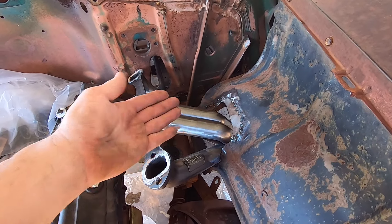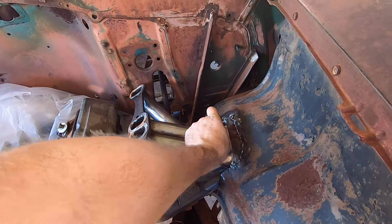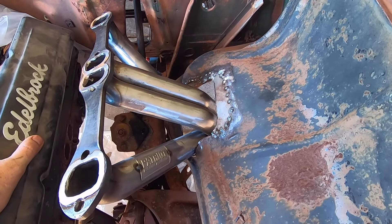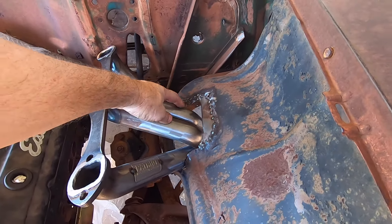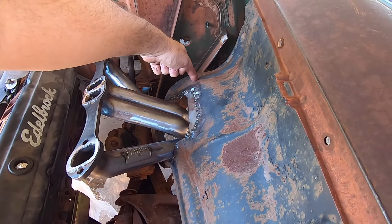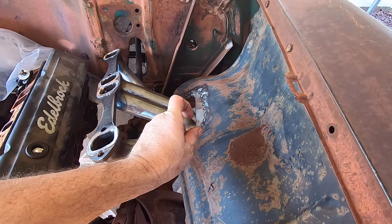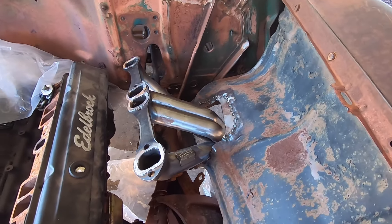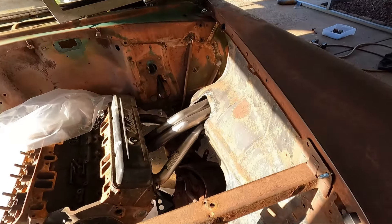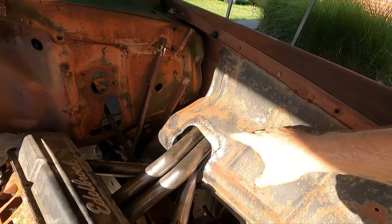I still couldn't get the header out even when I had it cut this wide, so I went ahead and made a filler and put it back in there - I never finalized this completely because I'll be cutting more. But this will look like a really nice opening. I wanted to mail-slot it - put sheet metal up in there and weld it all up, then grind it to contour, so it'd have a little inner flange sticking down. I thought that would look a lot cleaner and more professional than just having a hole cut in there. I got the fender on and two bolts in the header - it has about the thickness of my fingers clearance all the way around, so it contours the headers really cool.